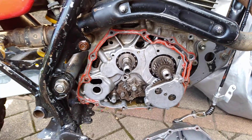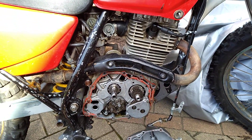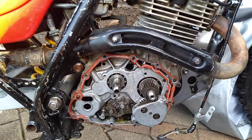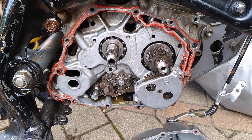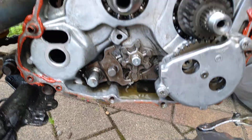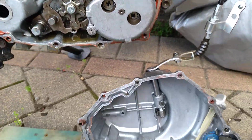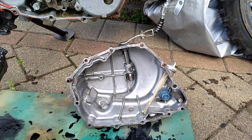I'm pretty sure this is a late 90s SL230 engine. It's very similar of course to the CRF230, but slightly different on this clutch cover side, because this engine actually did have a kickstart option with the electric start. I've actually removed the kickstart option and blanked off that part of the housing, so all of that's okay.